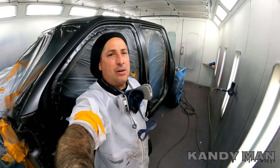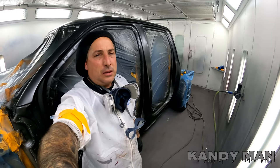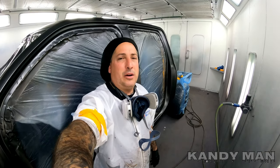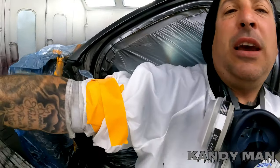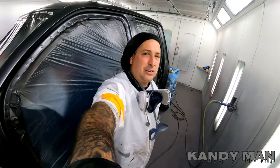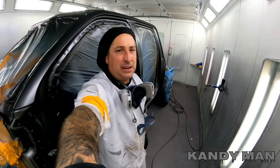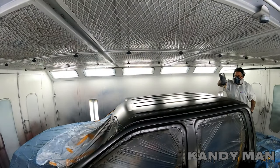So we'll drop it now, and then we'll be clearing it with the CC200. So definitely a big job. Definitely you got to get your stretching in on this one to get around it and definitely not stick your arm in it. So I got my arm taped up for the clear. That way I don't get it in the clear, guys. So let's go ahead and base this one more time with the drop coat. And we'll be hitting it at about 10 PSI on the regulator. And then we'll be going to the clear.